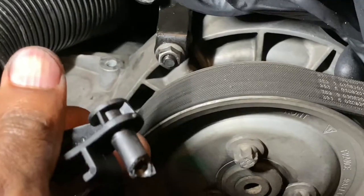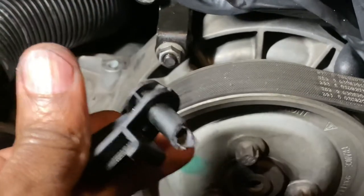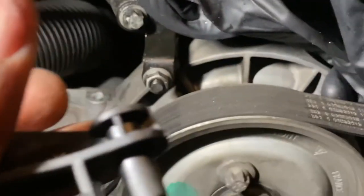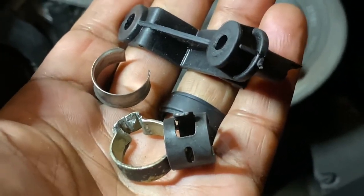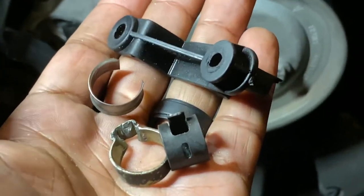I'm about to go make this out of metal so I never have this issue again. What I plan to do is drill the rest of this out and then find a small hose connector that will fit these hoses right here and connect it back. I'll also replace these little hose clamps with some that are easy to remove if I ever have to remove this again. I'm gonna go do that right now.